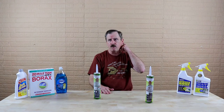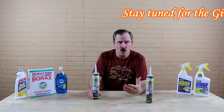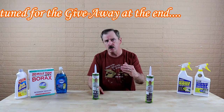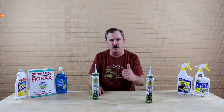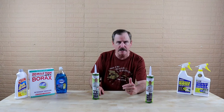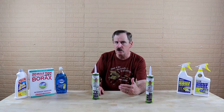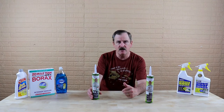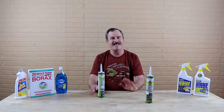You might ask yourself, how do I know when it needs to be resealed? I'm going to have a link down below covering what to look for when inspecting your unit for sealants. You're looking for cracking, peeling, bubbling — those types of things. Now, you don't necessarily need to remove the old sealant, but you do need to do a really good job cleaning it off. Rough it up if you can, and then just apply it generously. If you're putting self-leveling sealant on there, just goop the heck out of it. It doesn't have to be pretty to be effective.